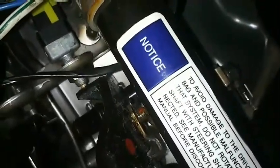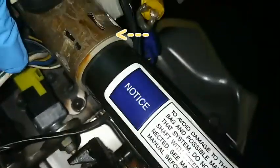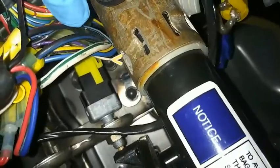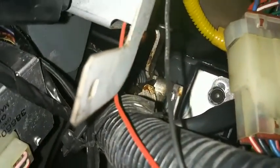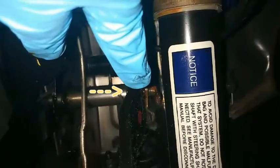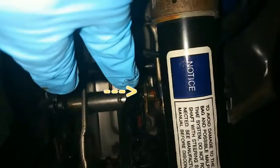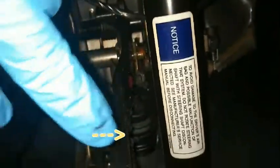There are two bolts at the top — one is right there, and the other is right back here above these wires. There's a small bolt somewhere up there on the driver's side. And there's also a cotter pin on the brake pedal right there. Pull that and you can pull the lever off. The brake pedal appears to be attached to the whole clutch pedal assembly, so you want to take it off that plunger right back there.